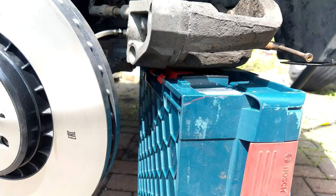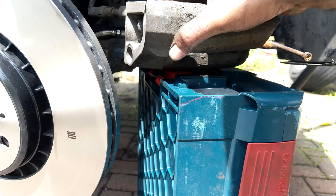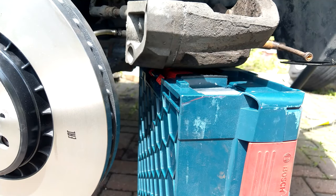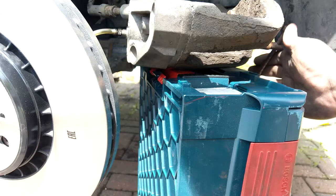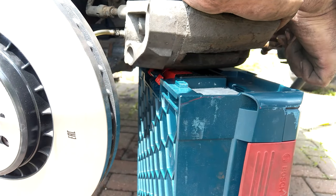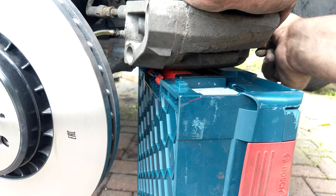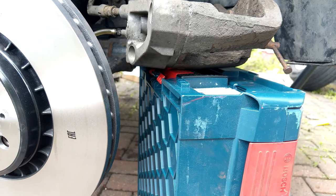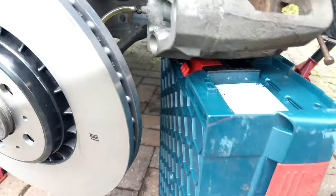When I'm winding back the piston, I attach a hose to the brake bleed nipple, undo the nipple, and then start winding in the piston. That means the worst fluid — the fluid that's been sitting in the caliper, been doing the most work, been subjected to the most temperature extremes — gets ejected from the braking system. All you do then is top up the reservoir with fresh fluid and pump the brake pedal until the piston meets the disc once everything is back together.